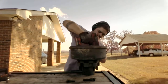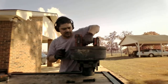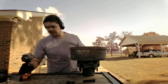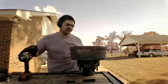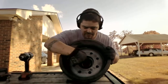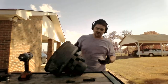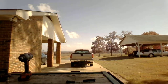I have to say though, this is part of the job — you'll want to find a thin wall socket to get in here. For this particular drum it's a 13 millimeter socket, but to get to these bolts you really need a thin wall socket to do that.